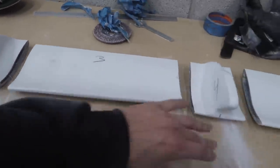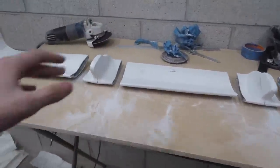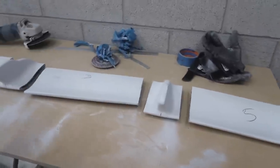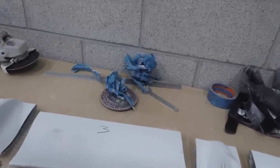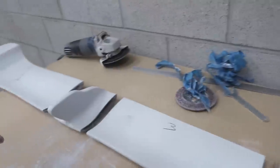So we are gonna be adding an inch more in between here rather than the sides. I know I kinda wanted to keep it, you know, all around, but this was the easiest way to preserve this and to kinda just make the math easy. Because it needs to be widened exactly 4 inches, it just makes sense to make, you know, 4 cuts and add an inch in between each one.